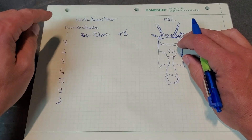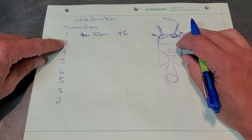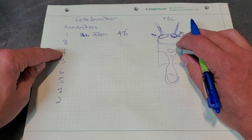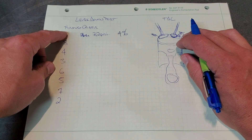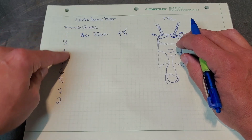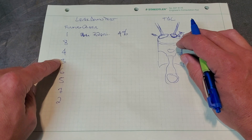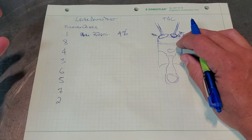I'm going to go through every cylinder. The reason I put this in firing order is to make it easier - every top dead center on compression is 90 degrees from each other on the crank. So you just put the hose on number eight, turn the crank 90 degrees and you're at top dead center, then put the hose on the next one, 90 degrees, top dead center. If your harmonic balancer has 90 degree markings, you're in luck. If not, put a white mark every 90 degrees and that'll help make things a lot faster. Seven and three are my curiosity points because I think I have a bent valve from the bent push rod, and number seven because of the crazy fouling on that plug.